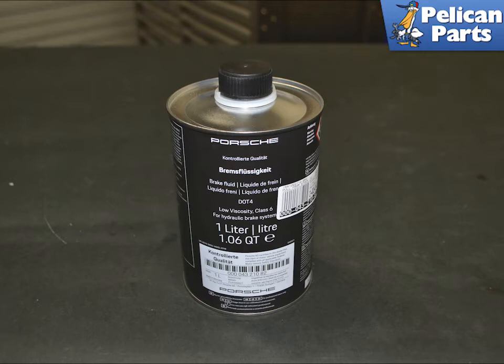When bleeding the brakes, always start with a new, fresh, unopened can of proper brake fluid for your 997.2. Never use a can that has been sitting open on a shelf, as it will have already absorbed water. A word of warning: brake fluid will destroy the paint on your car. Make sure not to get any on you or your clothes and transfer it to the paint while performing this work.